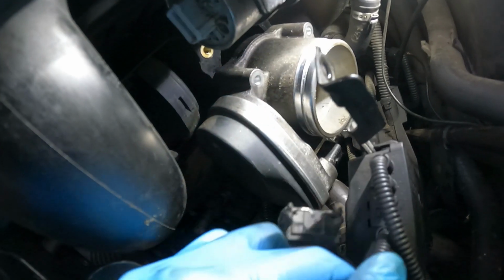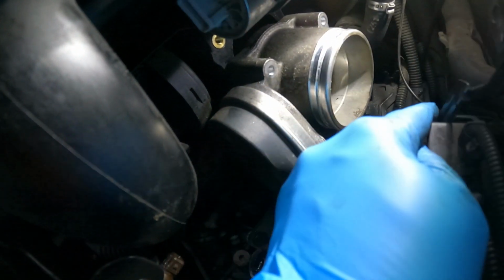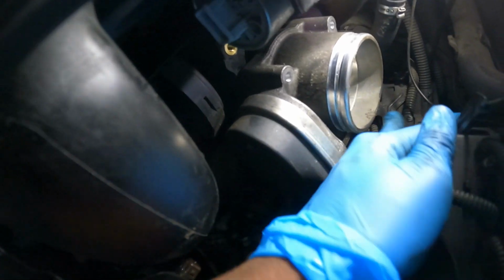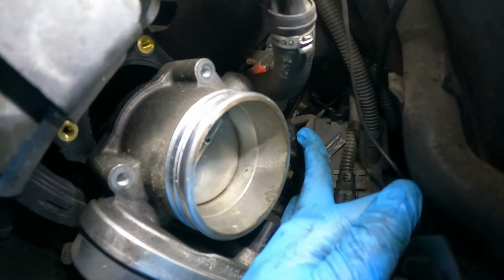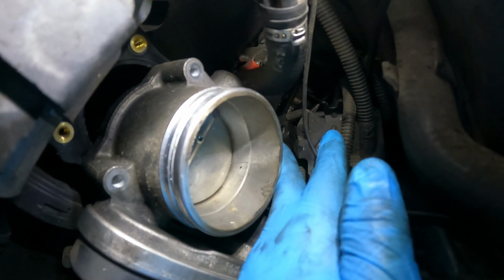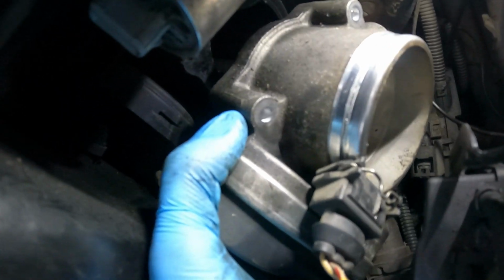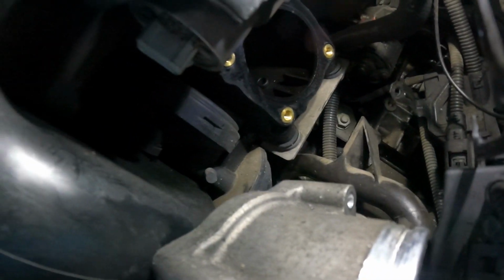Okay, guys. It's 4 bolts on this throttle body. It's really 5. Well, yeah, you got this bracket right here that's on there also. This bracket right here bolts to this. It's got a tab on it, I mean, a stud sticking out. And they're all 10 millimeters. So once we unloosen that, you just move it out of your way. Then, because we couldn't really see what was going on down here, we couldn't pull the intake back. But once we got that out the way.